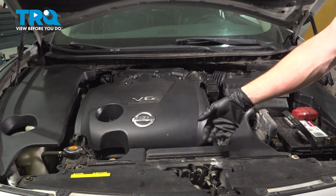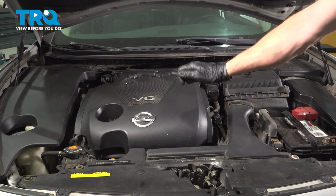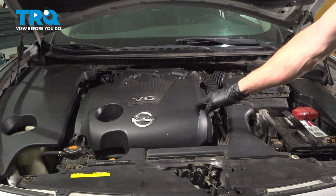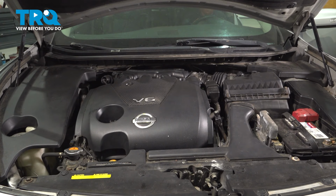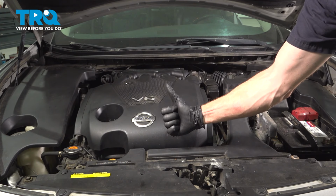Now the next thing we need to do is hop in the passenger compartment. We're going to put the key in the on position, turn it right back off, and then we can continue on to starting the vehicle. Typically, during the initial start, you're going to find a long crank scenario before it does start. Perfect. Thanks for watching.